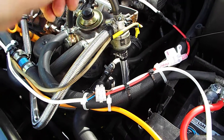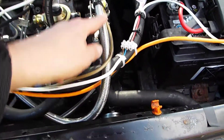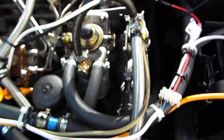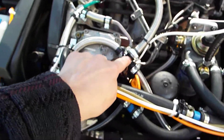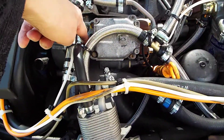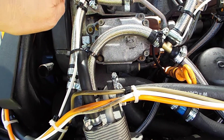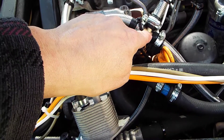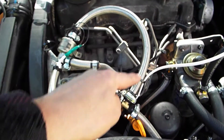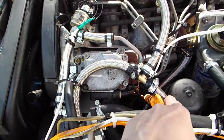Obviously when I first start, the veg isn't heated, so I'm running on diesel. The output comes out here — the valve is switched off, so the default is diesel out. Through the T-piece here, into the heat exchanger at the bottom, out of the heat exchanger, back into the Bosch fuel filter, and out of the Bosch filter. Anything that isn't used comes out here and round to a T-piece into a loop — it continually goes round and round. Obviously it uses some fuel, so this is the feed which tops it back up.